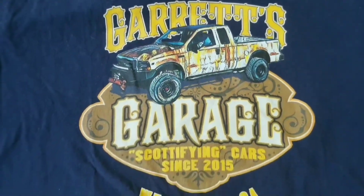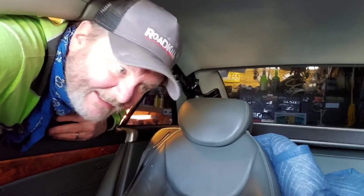Hey, we're inside the beautiful Mercedes and the beautiful Mercedes is inside the garage again. The transmission is still no bueno and I'm talking myself into opening it up again. I've pulled the scan on it and it's indicating one bad solenoid out of the eight that are on the conductor plate, and it's also indicating — one that's gone back since the very beginning — that there's something wrong with the position sensor.